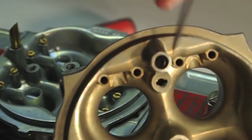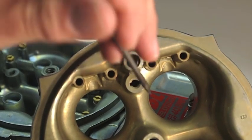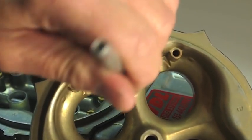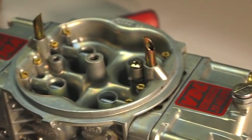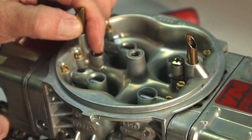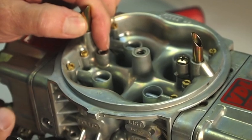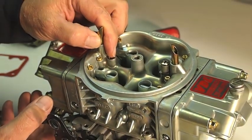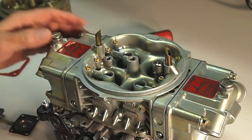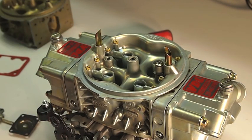In your main body you'll notice there's a cutout on each side that allows the fuel to come up. You can take a small scribe, a piece of wire, or a small screwdriver and go in on that side to get to your needle — just wiggle it and break it loose. Then put your finger over the top and activate the pump arm and listen for air or fuel to bubble up through there, which tells you everything is working as it should. The reason I say put your finger over it is that if it gets a good shot of fuel, it can blow that needle out, drop it down into the Venturi and into your engine, and that's going to cause you great concern.